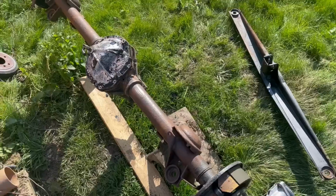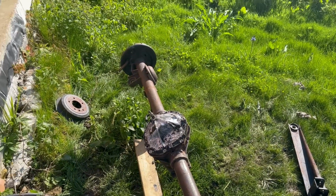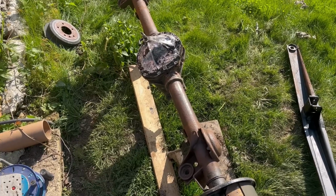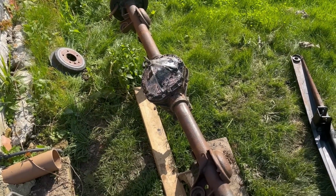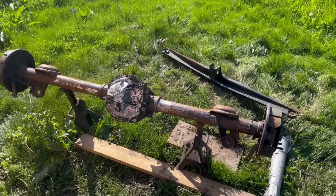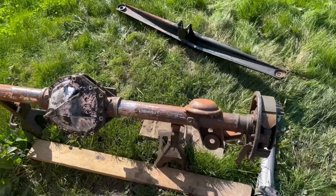The Jotun is surface tolerant and it would go over that and it wouldn't cause it a problem at all, but I think I might put Hydrate 80 over the whole thing anyway, because that can act as a primer, and then it shouldn't take too long to go off with this heat, and then Jotun over the top. So that is what I shall do. That's had the lightest of tickles with the sander. Now I'm going to paint Hydrate 80 on it.